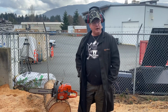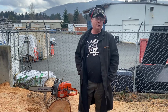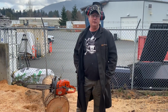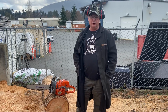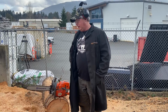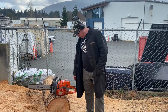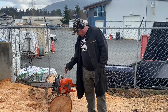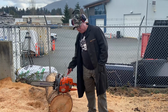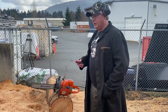Just want to show you on the auto tune. The way the auto tune works is it senses humidity, temperature, elevation, type of fuel you're using. And on the common service tool, CST it's called, the only way it really works when you plug it in is it tells you the hours it's run, and you can reset it to send it back to factory parameters.